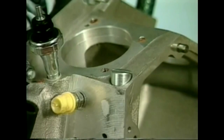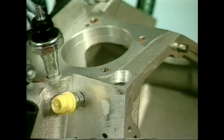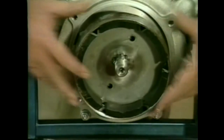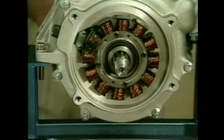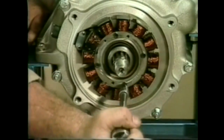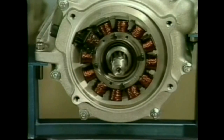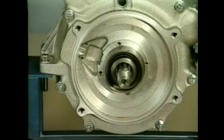To complete the dismantling of the oil pump, we'll need to remove the remaining seal. Using a probe, we can push the seal out — this seal will also need to be replaced. Using a screwdriver, we'll remove the tappet screen plug from the top of the gear case — it also has an O-ring that needs to be replaced. Next, we can fish out the spring and oil screen; the screen actually sits beneath the spring. Because we've previously turned the rotor around, we simply slide it off. Next, we remove the washer, which also slides off. Now remove the four bolts with a Torx key. With a Phillips head screwdriver, we can now remove the screws holding the nylon retaining bracket — this too can be removed. The stator, which may be difficult to remove, is slipped off and rested on the shaft. With a blunt instrument, push the plug back into the motor. Once this is free, remove the stator.